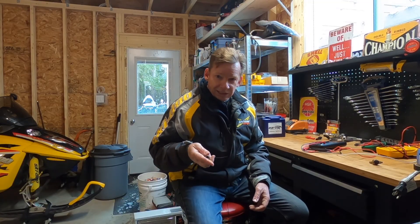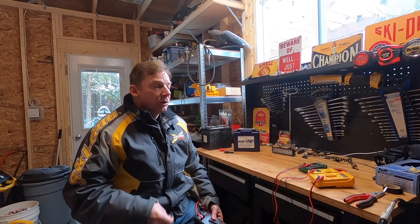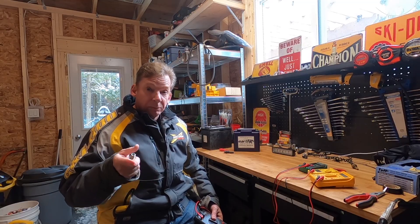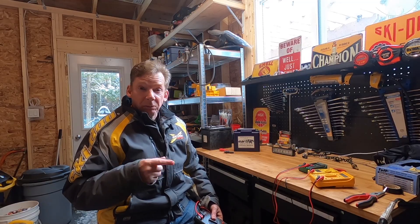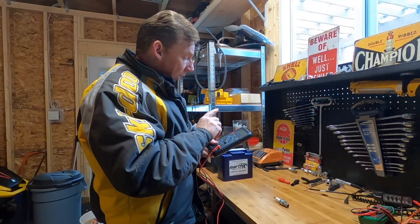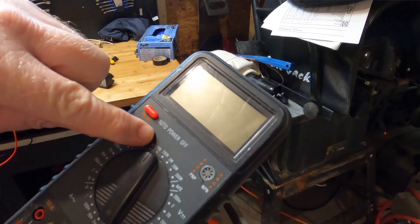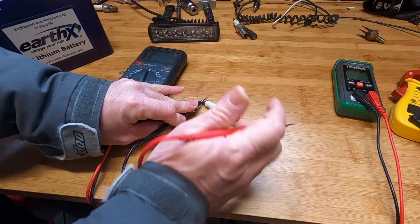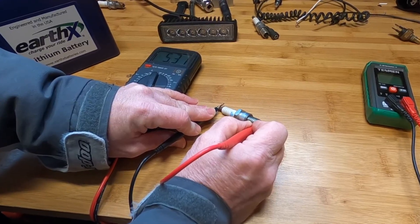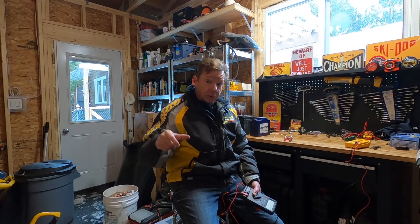Spark plugs will have 4,000 to 8,000 ohms of resistance — I know this spark plug has around five thousand. Corrosion, vibration, and excessive heat can all cause damage to the spark plug, caps, and wires, and end up changing the resistance in that circuit, which can affect your spark. On my multimeter, I'm going to select ohms — the little horseshoe — and go to 20,000 ohms. I want to be careful not to touch anything other than the center electrode, and I have 5.31 kilohms. When checking for resistance, make sure you isolate whatever you're checking from the circuit — disconnect it.